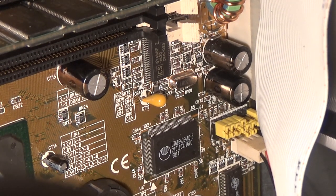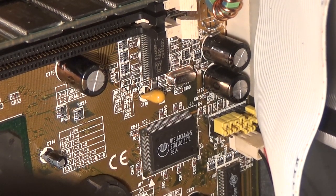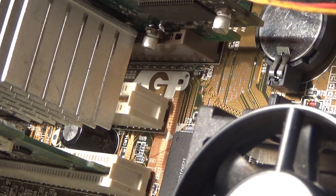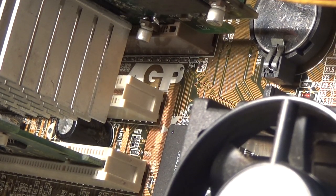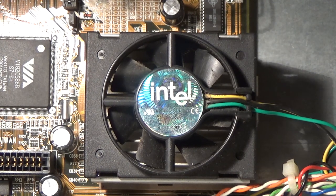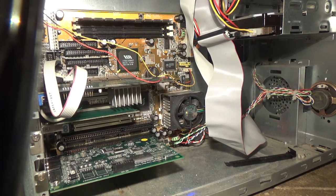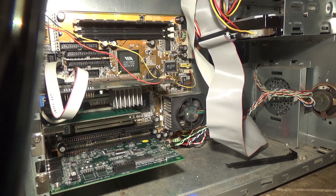Nonetheless, their SpeedSys CPU score was pretty much identical, but the TMC was about 20 megabytes per second faster in level 1 cache, a meg faster at level 2, about 10 megs faster in memory bandwidth, and it was, however, 4 ticks slower than Chaintech in Doom, and barely a frame faster in Quake. Yeah, so the TMC may actually be the faster of these two boards, although do bear in mind I've got some fairly conservative settings on for now. Not many, but we could probably make this go a little bit faster and catch up with the TMC if we wanted to. I do think, though, that with identical settings and an identical configuration, the TMC would score higher than this board overall. And it's strange how boards from companies that seem about to disappear tend to do that.